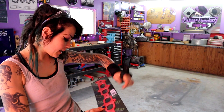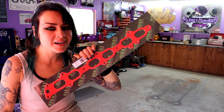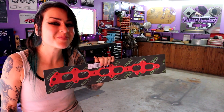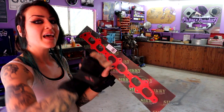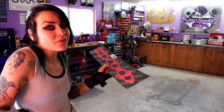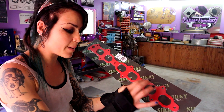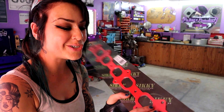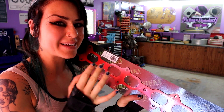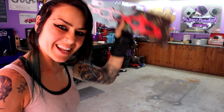This is the thermal intake manifold gasket. You're probably wondering, Faye, what the heck does this thermal gasket have to do with cooling? Well, this is going to produce a heat barrier between the cylinder head and the intake manifold. Metal transfers heat really easily, so by using this gasket it's going to protect and make a barrier between the hot cylinder head and my lower intake manifold. In doing so, it will prevent the transfer of heat from the cylinder head to the intake manifold — which is also probably going to add some horsepower because the air will be cooler in the intake manifold.